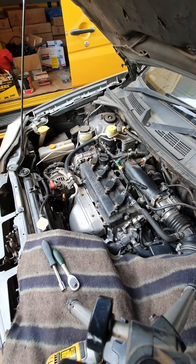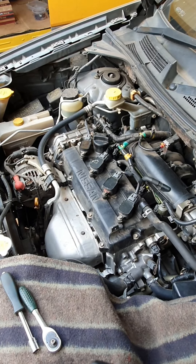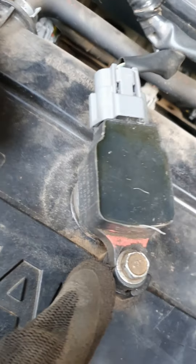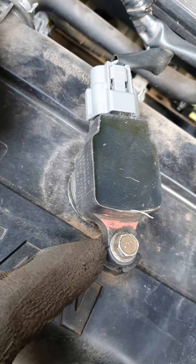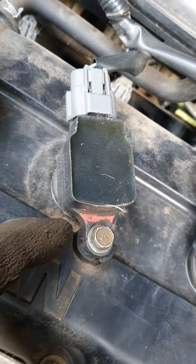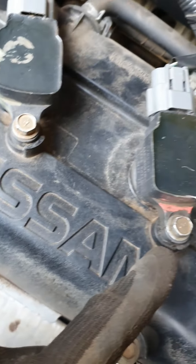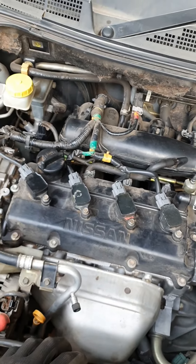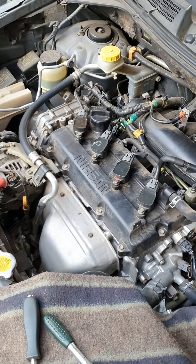That will not work. I'm suspecting we may be forced to damage the coil pack head because it's already cracked, so I can probably jimmy a screwdriver in there and try to use the impact as the screwdriver holds it. Now you can have a better understanding of what goes on when you come in for a spark plug change and things go south.